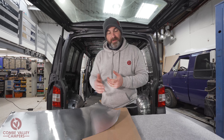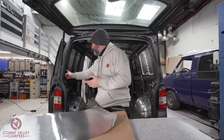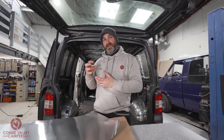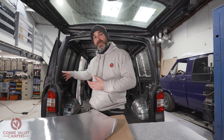If you've been around camper vans, when you carpet over the hollow apertures in the bodywork — especially in a lighter colour carpet — over time the dirt goes through the holes either from the outside in or from the inside out, and what you get is dark spots and also sagging over time through those holes.